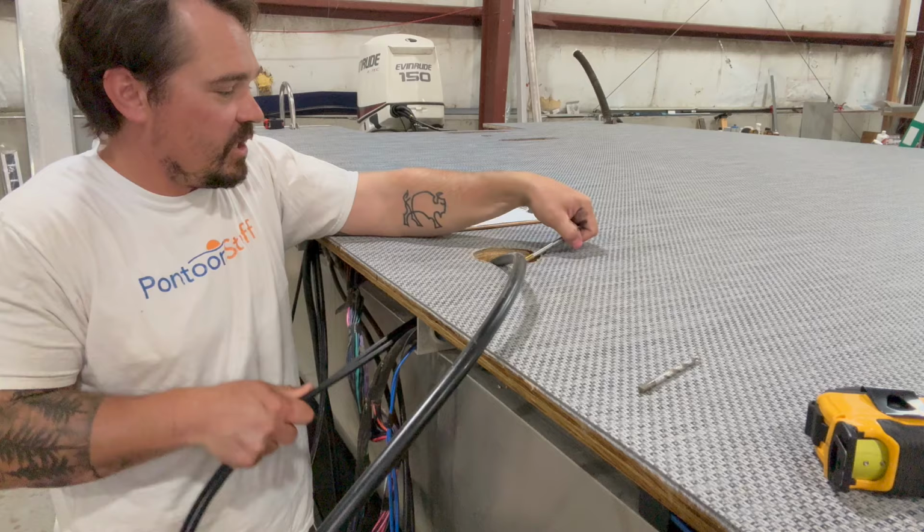And if just the head comes off at first, that's fine. I grab my pliers, I back it off, just reverse gently, and that gets the rivet off, gives me a clean drill bit. But I am gonna need to run this through all the way and clear that hole so that when I bring my 3/16 rivets back in to rivet this back up, my hole is clear.